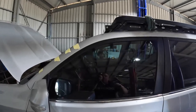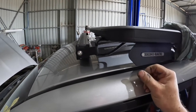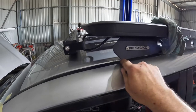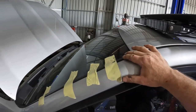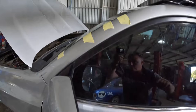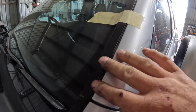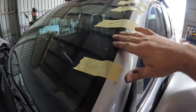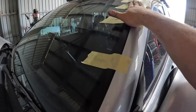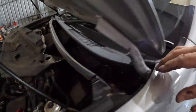Got the roof rack on. If you have a look down here, there's a little rubber strip that comes out really simply — I've just run two lots of 3mm twin wire under there. This section is a bit more painful; there are four blue clips under there which you're better off starting from the bottom. Just peel it forward slightly, get a pick in there and pick one out. I put a little bit of sikaflex on each of the connectors and just push it down and keep it there for a couple of hours to make sure it stays.